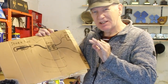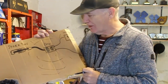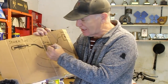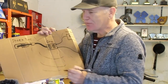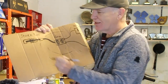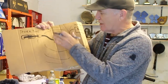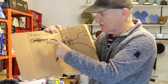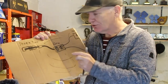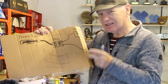When the power is cut off, even for a moment, that electromagnetic field collapses back inside the coil, and by doing so it induces a current in the secondary coil at 45,000 volts. That then travels down the ignition lead, through the central rod of the spark plug, jumps across the gap, and is finally earthed through the third component — the body of the plug — which is screwed into the engine. The engine is fastened to the frame, and the frame is linked to the battery, completing the earth. Critically, the spark doesn't happen when the coil has power — it only happens when the coil's power is cut.